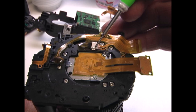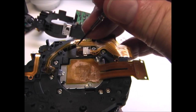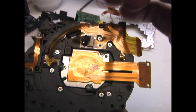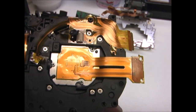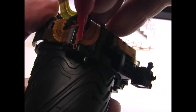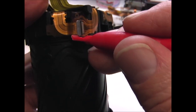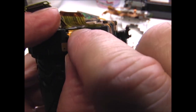On the back of the lens, I'm going to remove this cable — it just pulls straight out. When you remove this back cover from the lens, this ribbon cable is going to go through this slot, so we have to feed that back through there when you reassemble. On this side of the lens there's another ribbon cable, and it also has a latch that has to be flipped up — but this one's different, it's on the right hand side. You want to look at how this is routed through here — it's clipped on these little pegs and you have to put this back on here when you reassemble. And now this cable can pull straight out, just remove it from these little tabs.